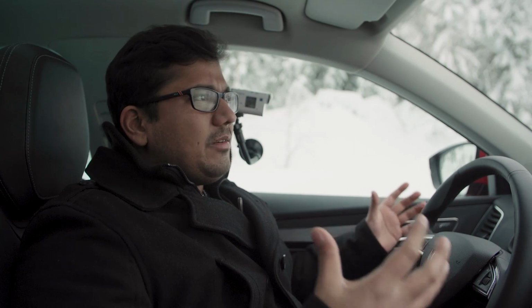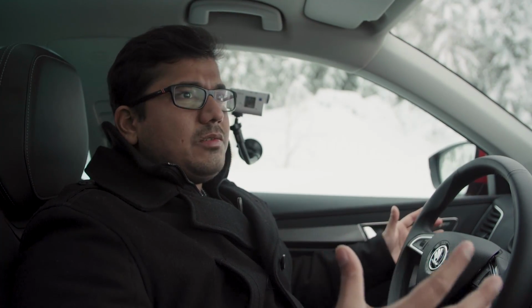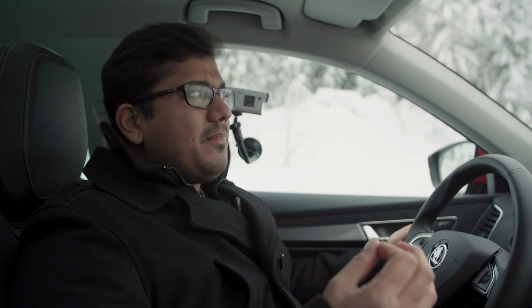What is the benefit of these kinds of four-wheel drive systems? Because like we've discussed, this is not really a 4x4. There is no transfer case, there is no central differential. Even though this has electronic locking differentials, they're more brake-based and not really a fully locking differential mechanically. But what is the real use? These are not off-roaders in the true sense. You're not really going to be able to take this car rock climbing or to Moab or things like that, but it definitely helps, especially in the snow.